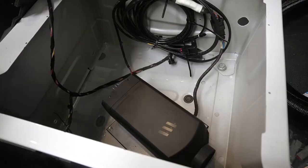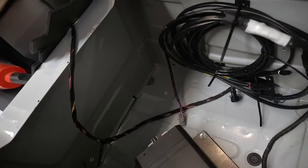I'm going to zip tie it so it's not hanging down, doesn't get caught on anything. I'm going to put in wire loom, and I'm going to put my grommet or something, so it's secured nice and tight. I think there's plenty of wire to do that. And the only other thing I think I have to do is make up the wire for the fuel pump. Big seat's looking really nice. And so I'm done in there except for putting the fuse on. I'm going to wait to put the fuse on until I'm totally ready. I need to go get, I've got so many hole saws except for a 2 3/4.